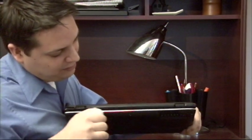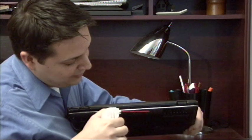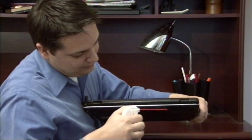From an angle here, blow some air into that. You want to do it in really short bursts, because if you hold the button down it'll actually condense the air and it'll come out as liquid drops — and you don't want that to get into your computer. Do it at an angle so the air comes in and goes out, pulling along with it any dust it might be picking up.